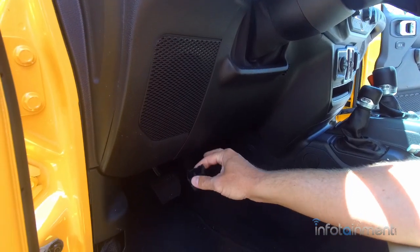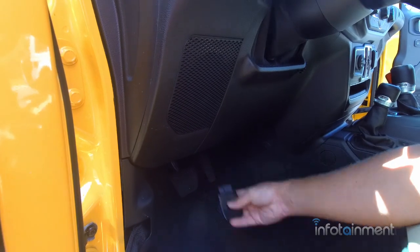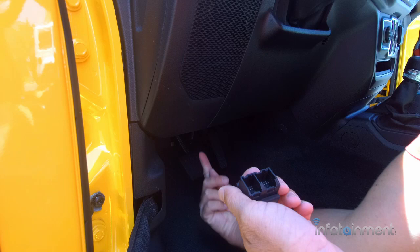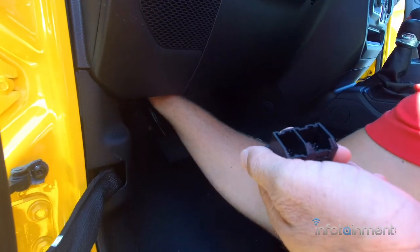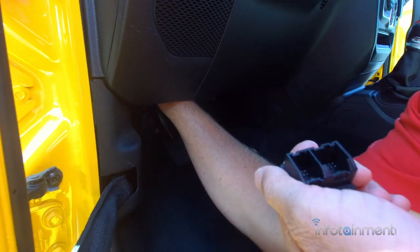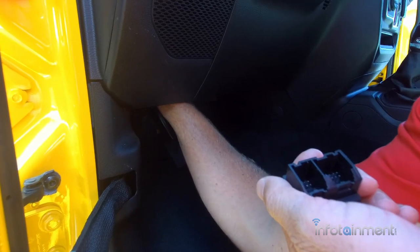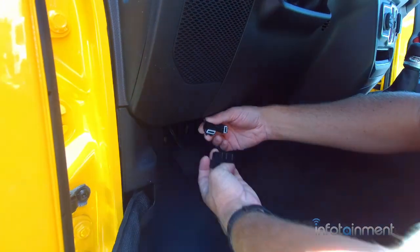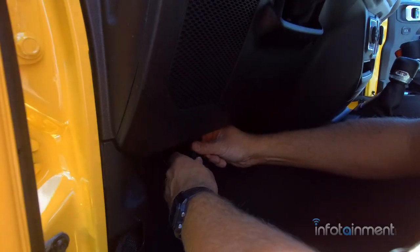All right, now to program your Jeep, you are going to use this OBD Genie tool or fob. But before you run it, you have to disconnect the security gateway module, which is located just above your OBD2 port. You'll notice two connectors here. So you're going to want to reach up, press in the tabs, and then pull them out of the module. And then plug these two connectors into the gateway bypass.